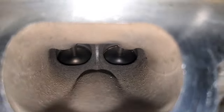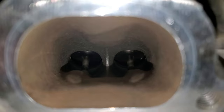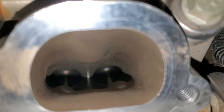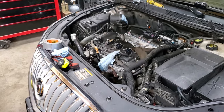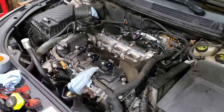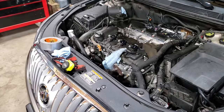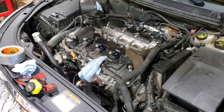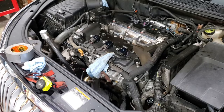The walnut blasting is done — as you can see, nothing compares to walnut blasting. Nice and clean. It took approximately 30 minutes per cylinder. I hope we can all agree that the BG products do work, however they are no match for really stuck-on carbon that's been on the valves a long time. The best solution is to clean the valves with the walnut cleaning machine, and after that's been performed, all you should have to do is periodically run some type of GDI air induction system cleaner through the engine every 15,000 to 30,000 miles to keep any carbon buildup from becoming a problem.